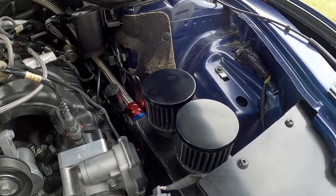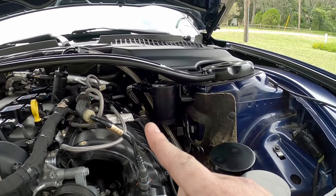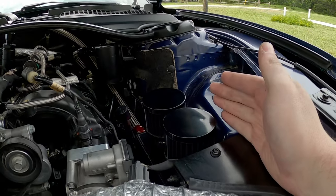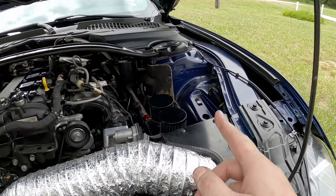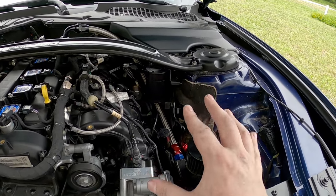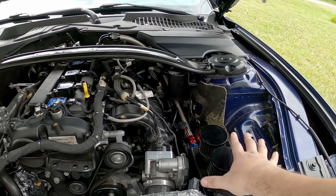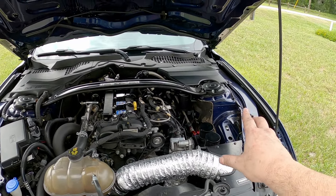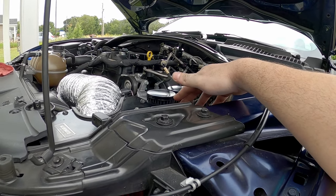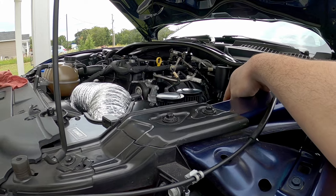Taking a look here, there's a little bit of vapor coming out still — I figured there would be, like there was before when it was just venting out the top. But that is a whole lot less; I can barely see it. It seems to be working how I figured. It isn't a drastic improvement since I do have a vented catch can tank, but now I kind of have the benefits of both systems. Since there's a vacuum being drawn onto this, it should keep it from getting overwhelming. And I barely even smell it, so those gases seem to be getting sucked back into the engine.